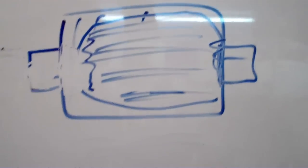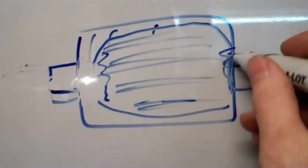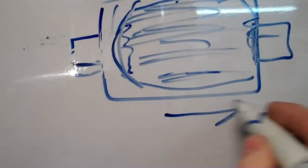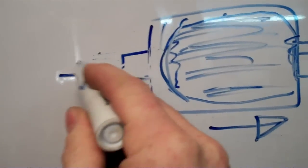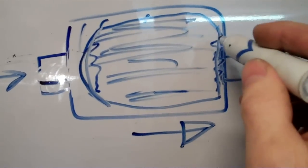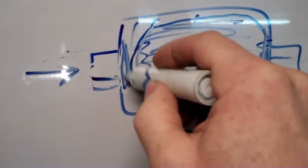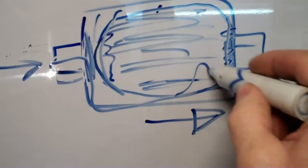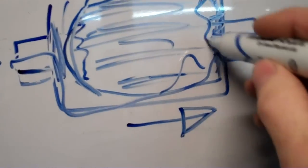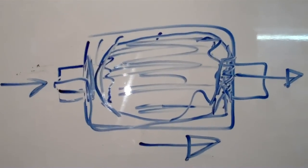The other possibility is the fuel filter. It just looks like a can with a couple of threaded ends. Inside it's got a bunch of paper folds and a little filter element — the fuel goes in one side and out the other. If it gets all plugged up and the internal element comes undone, the whole filter element and all of the crud will block the outlet. This doesn't typically happen, but it does happen occasionally.